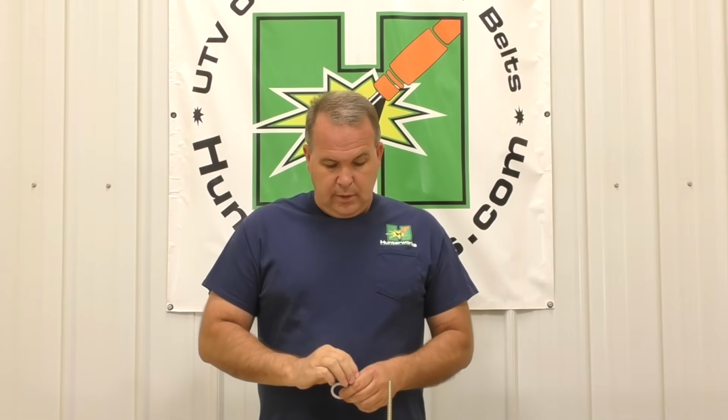Black washer, turbo only, turbo S, turbo whatever, turbo, you have to buy it separate, only if you need it. Thick washer only comes with the new quick quiet thick belt. You can't buy it separate because you don't need it separate. It only comes with the belt. Use it. You have to use it with a thick belt. You could run it with the others in an emergency, it doesn't do anything, but it must be ran.